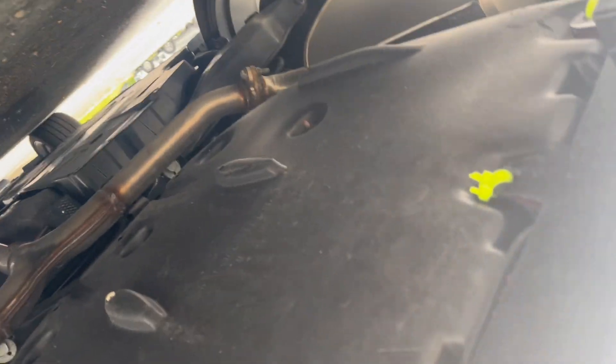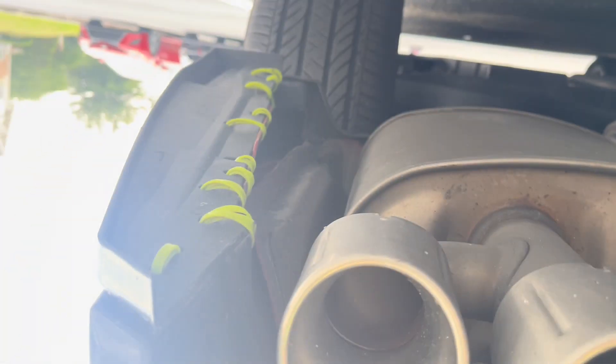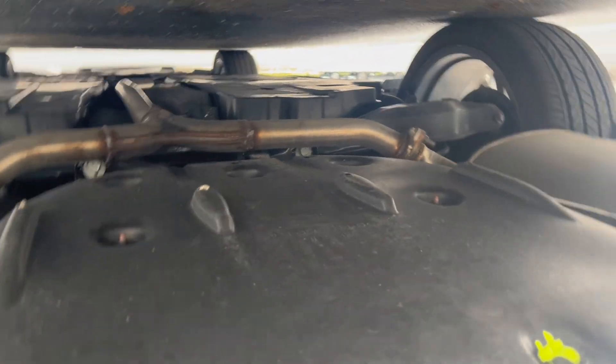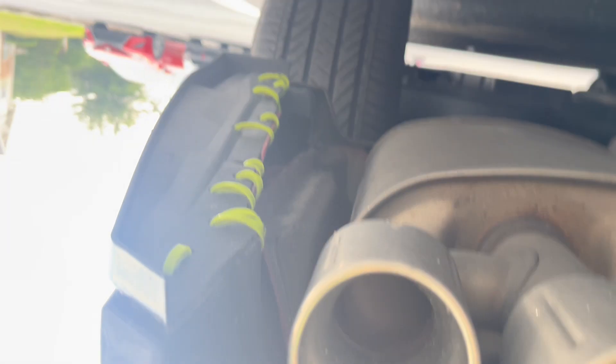When you heat up 3M tape it pretty much creates the tape to be more sticky. That's why when it comes to upgrades you tend to want to do it on a hot day — not if it's cold outside or raining. I pretty much did all my upgrades when it was cold and raining, so I took it inside and did a long preparation, making sure it was stuck and wouldn't move. I actually put half my weight on there and it didn't move at all. Depending on how often you clean your vehicle — weekly, bi-weekly, or once a month — you are putting a lot of water in that area and doing soap, which can create the tape to weaken. But if you prep it well, apply pressure, and heat it up, that shouldn't be a problem.